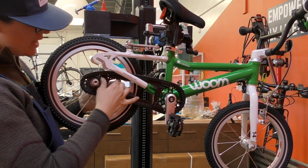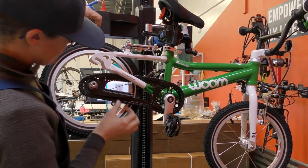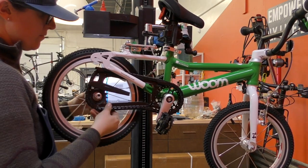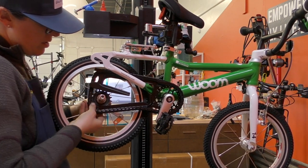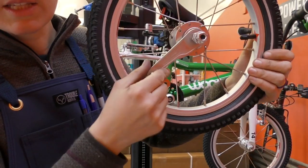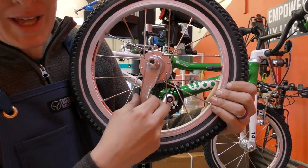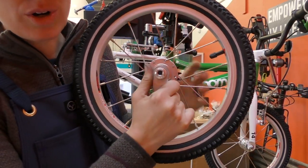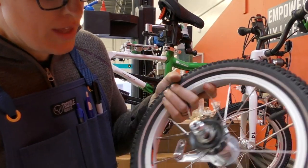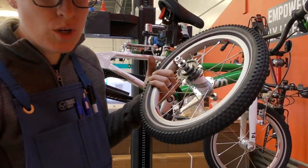Wheel's off — I'm going to slide this forward a little bit. Here is your coaster brake wheel. On this side is the arm that attaches to the bike frame, and that's what actually allows the brake to work — if this isn't engaged, the coaster brake doesn't work. So put this aside, save it for the tire and tube, but hopefully you'll never need it.